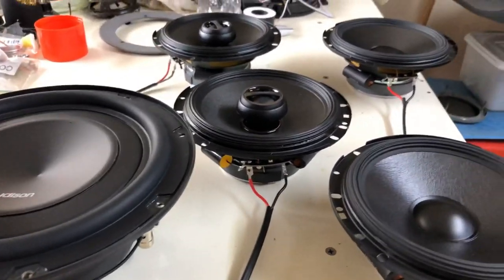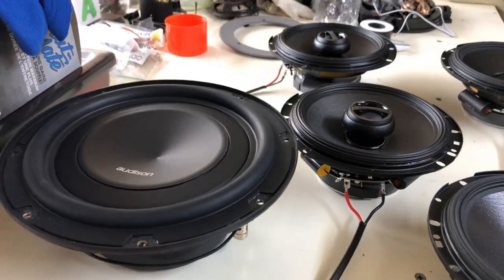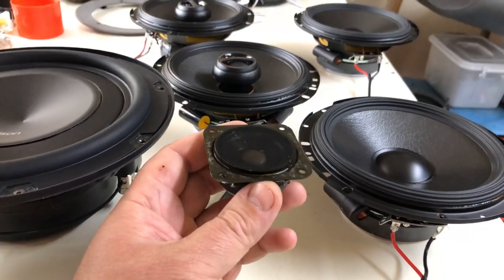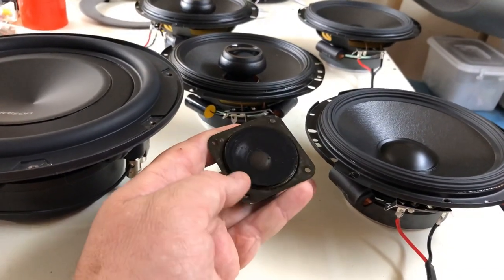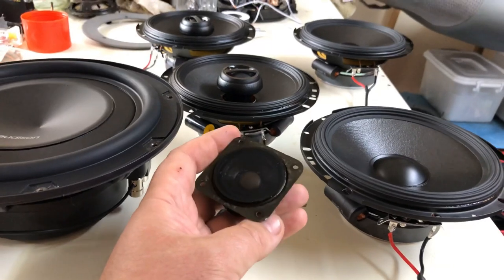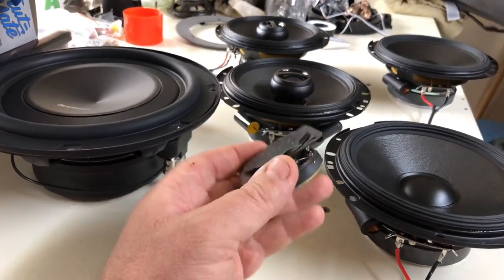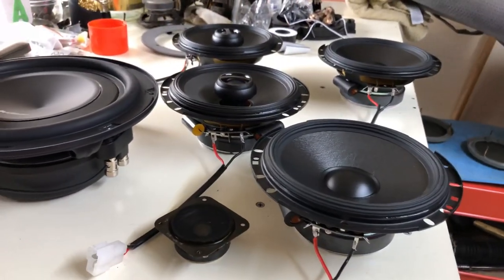Now, the tweeters have been put in. There was a little bit of an issue with the tweeters, which we'll have a look at now. Here's one of the original tweeters. It's just a bit wet. It's been sitting outside. Don't need it. These were actually glued in. When we look in the car, there's a metal bracket that these are screwed into. The screws were glued, and there was a small bead of glue around the speaker edge. Mate, these things were a nightmare to get out. Really, really hard to get out. Plus the wires coming off the tweeters go straight into the harness, so there were no connectors. So I had the auto electrician put connectors on. Next time, if these ever need to come out, it's nice and easy, with the same kind of connectors as these ones. Nice and simple to disconnect next time.